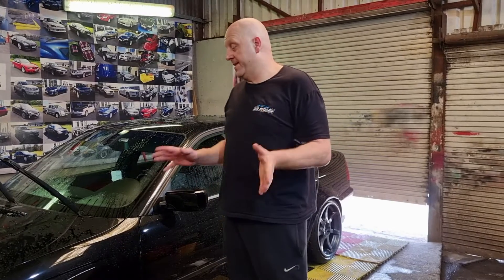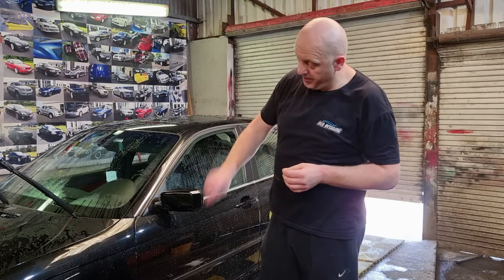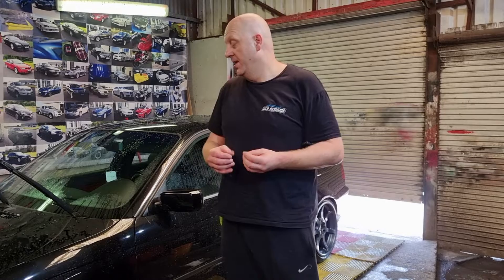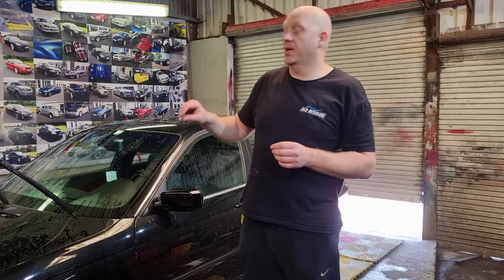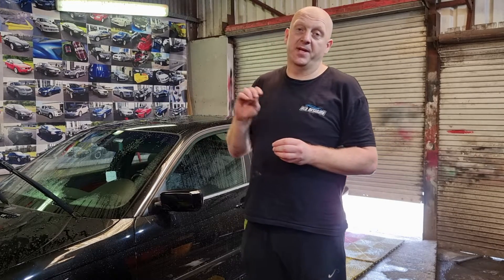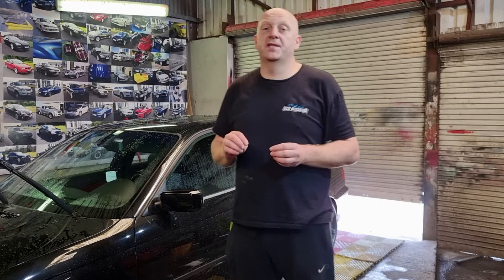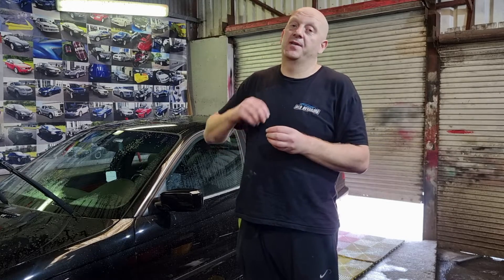To recap this video, I think the product does really well. Even though there is a difference in hydrophobic properties between the top compared to the bottom, everyone knows that the bottom part is always exposed to the harshest conditions — that's why the hydrophobic properties are changed. The biggest thing in this case is that the car got proper maintenance all the time since application, but it never got any top-ups. The car was never topped with any quick detailers, sealants, etc. The coating is a four-year coating, however, when it comes to any sort of coatings, I know for a fact — as I've tested many of them — that there is no coating that will have perfect hydrophobic properties for the full duration without adding top-ups.